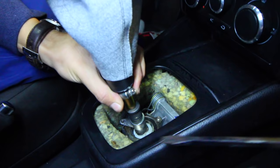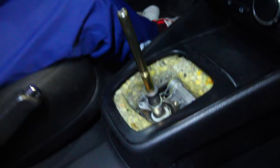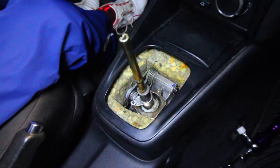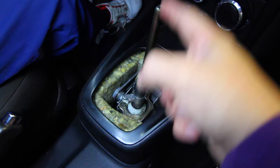There's a little clamp securing the shifter in place. We remove that clamp with a small flathead and take it out completely. This is the shifter — this fork right here is what's going to be replaced with our new piece. The distance from here to there is going to be greatly reduced. This piece is all going to be replaced with our Megan Racing short shifter kit.